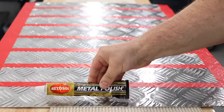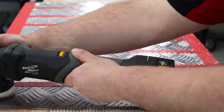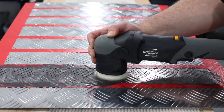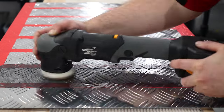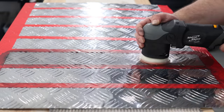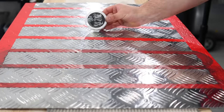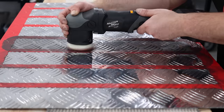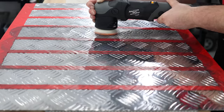The third test panel is aluminium, and I used it because I wanted to look at how these polishers give varying results depending on whether they're used to restore softer or harder metals. Some of the more aggressive metal polishers can both level defects and finish reasonably well on harder metals, but on softer metals they may not finish quite as well. While some less aggressive polishers struggle to remove even minor blemishes on harder metals, they can finish almost perfectly on softer metals.